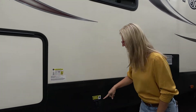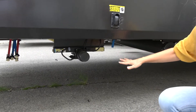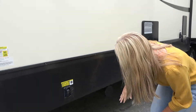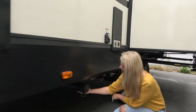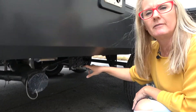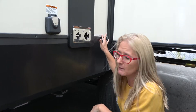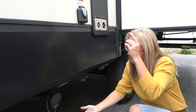This is your electric stabilizer jack. These are stabilizer jacks, not actually jacking up the trailer jacks. And you've got also a spot here to put your sewer hose. Coming back to here, this is where you're hooking up your sewer hose. I'm noticing that there's two valve pulls here, so I think what you've got is two gray tanks and one black tank, and yeah, that's how they're labeled here. There's actually an LED light right there so that if it's dark and you're trying to hook that up, you can see everything you're doing. That is an awesome feature of convenience.